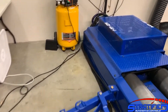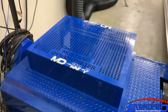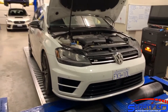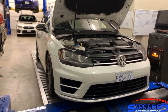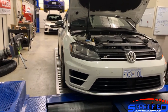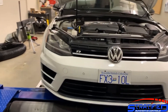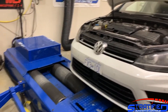You can see the eddy current brake for the dyno right underneath this cover here. The importance of a load-control dyno is that when we run the car on the dyno, we see representative behavior to what we see on the street. A third gear pull behaves as though the vehicle is driven in third gear, a fourth gear pull behaves as though driven in fourth gear. The majority of our pulls were done in fourth gear, with some stress testing in fifth gear covered later in the video.